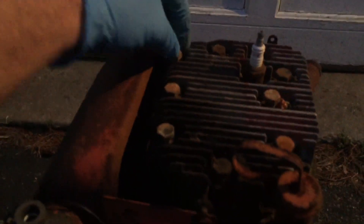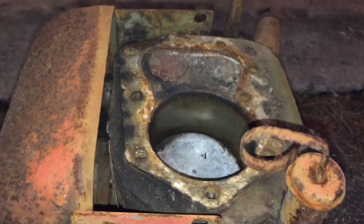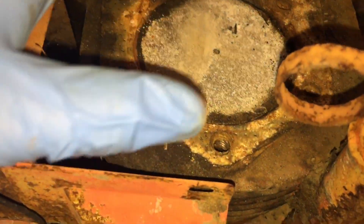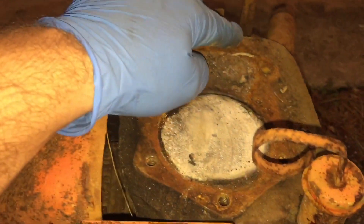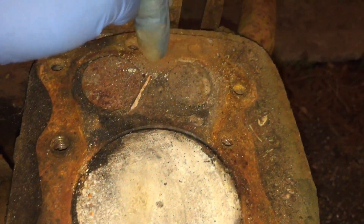I had taken this head off at some point. I need a tool to loosen these bolts — they're kind of hand-tight but rusted in there. Let's take it apart and see what's under this mess. It needs a little cleaning up but turns over freely, and the bore doesn't actually look very bad at all. I want to see if the piston has any markings — whether it's been rebuilt. There's a head gasket, and also a head bolt that's broken off near the exhaust — probably from a previous owner.